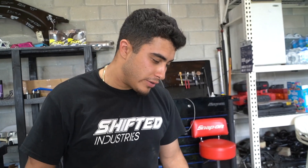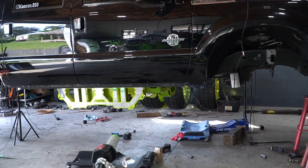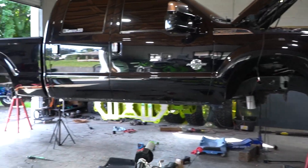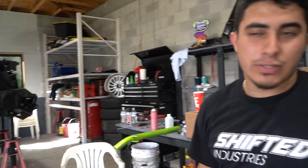Quick update: PJ finally came back — he was super rushed to get home because he wanted to ride dirt bikes. I drilled the cradles from last night. I was waiting for the cross member that PJ brought today so I could put in the index plate and cross member. I'm mocking that up now. I still need to put this cross member that goes cradle to cradle, and then I'll start on the rear coilover perch. The front buckets haven't even been unwrapped yet.